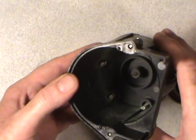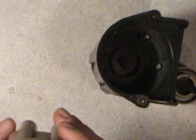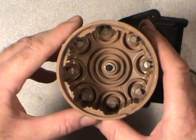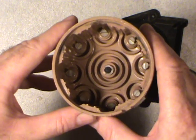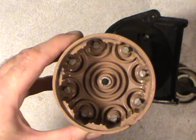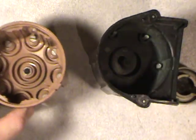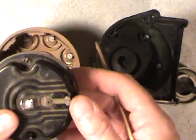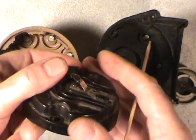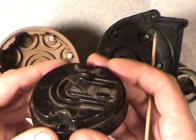That little button is so tiny. I can give you a comparison with the one they used before they came up with that. You can see the size of this carbon button in this cap — this is out of a Chrysler product, but it's similar to the GM ones when they used to have points distributors before they went to the high-energy system. That carbon button in the middle of this one is about a quarter inch and it's solid — not spring-loaded at all. This is a GM rotor they used with the points-type ignition; it had a big healthy piece of steel on there that created a spring and a connection to that center carbon button in the older cap. You'd be hard pressed to ever wear one of those out.